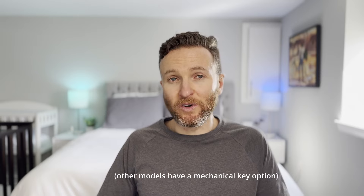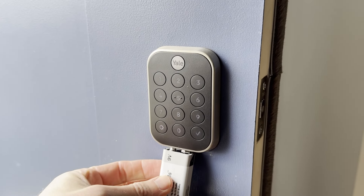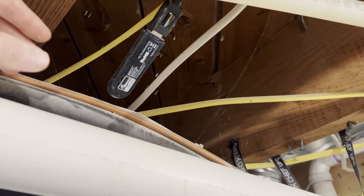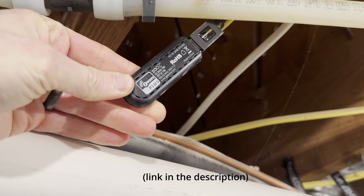The lock itself has a different shape on the back — it's smaller in terms of vertical length so it takes up less space on your door, but it is a little bit thicker, probably because of the battery arrangement inside. This lock also does not have a mechanical key slot, so if the batteries were to die and you were locked out, you can again use a 9-volt battery to power it back up and get inside. I got this with the Z-Wave module, but there are options to get Wi-Fi or Bluetooth-only versions. Because I'm using Z-Wave, the Z-Wave hub does not need to be directly nearby the lock like the Wi-Fi modules need to be near the other two locks. But of course that does mean you need a Z-Wave hub — you could use a Ring Alarm or SmartThings. In my case, I've added a Z-Wave hub via a USB to my Home Assistant. Unlike the Wi-Fi version, this does not have native support for Google, Amazon, or Apple HomeKit, but because I've connected it to Home Assistant, I'm still able to take advantage of any of those smart home platforms.